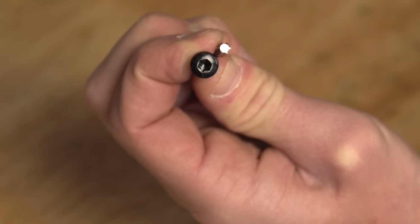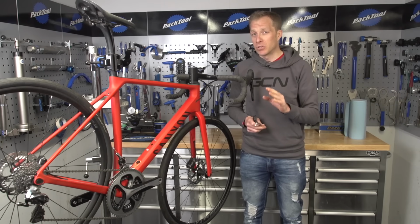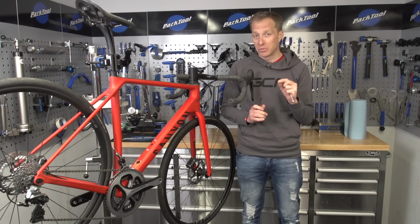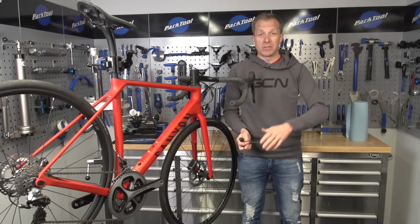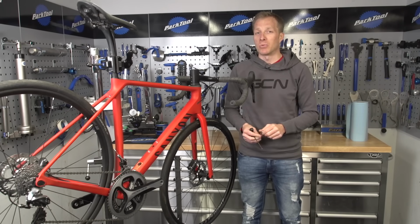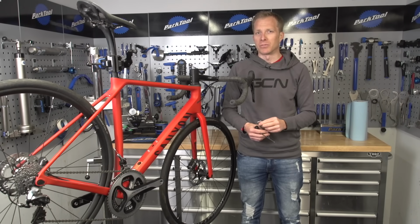It is possible, however, to use an undersized TORX key on one of those sockets. So pay a real good deal of attention when tightening them to make sure you're using the right tool size and the right socket size, because you don't want to start rounding off anything. That's never any fun. Of course, if you don't have any TORX fittings on your bike, you can ignore everything I've just said. But be aware, it is coming into the bike world more and more, so it's likely in the future you're going to have to give in, and you're going to need these TORX tools after all.